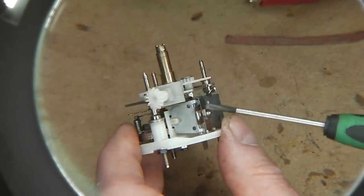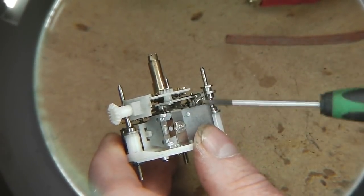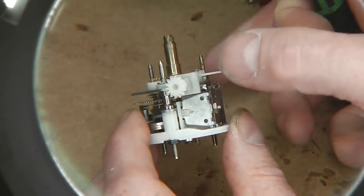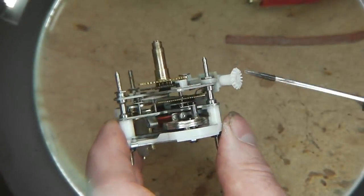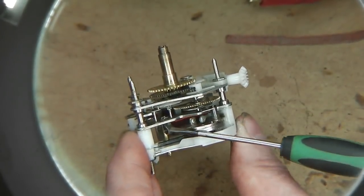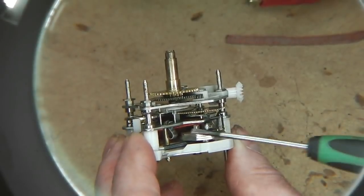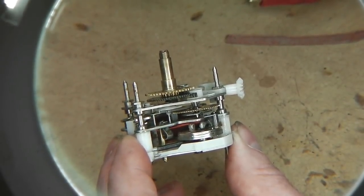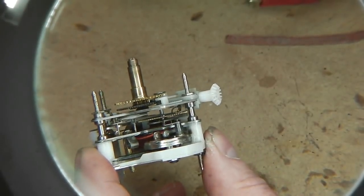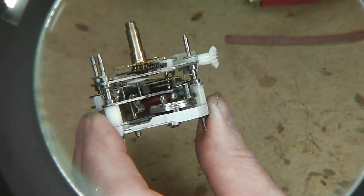If the contacts were damaged, you could just have the chip every minute pulse the solenoid here, and you wouldn't need the contacts anymore. So it would be a sort of hybrid clock. It would be self-winding on the timer circuit and throwing this back. And it might not even be approaching the contacts before it does another pulse and keeps throwing the weight back. You wouldn't want it happening too often. You'd like to get it probably once every minute, throw the weight back. Then it wouldn't need those contacts anymore. Okay, if yours were beyond salvage.